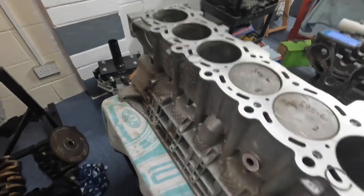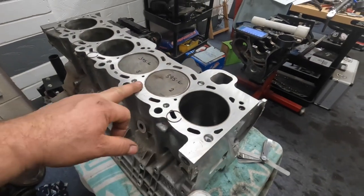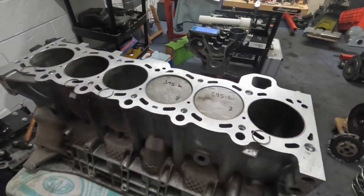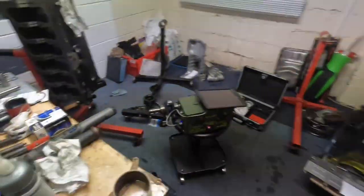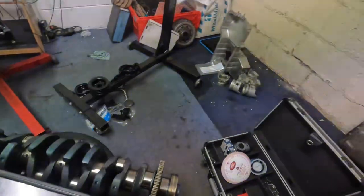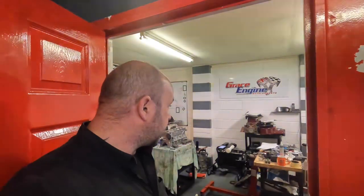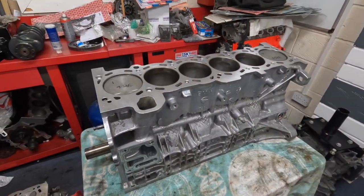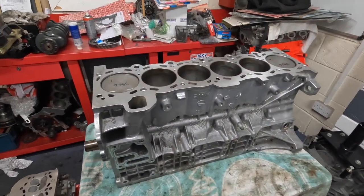This is the bottom end for the 24-valve BMW M54 engine. I've lightened all the pistons on the skirt. What I'm doing now is gapping the rings, then fitting the pistons back onto the connecting rods, and then fitting the pistons — I've honed the block and refaced the block as well. The crank is down there so I just need to clean that, and then it's ready to refit. I think this is actually going to be the last engine we do in my old engine build room before we move everything to the new one.